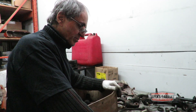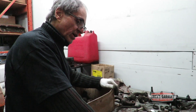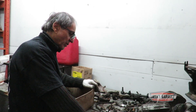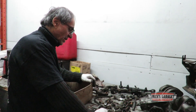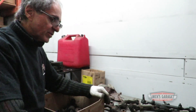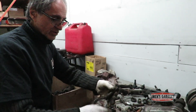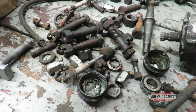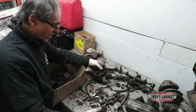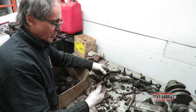The Kowalski project: my car came with drum brakes in the front and I want to convert it to factory disc brakes up front. I've got a pair of spindles, the caliper brackets, the calipers, and the discs, but then you need all the hardware — you've got to have the right bolts. So here's a mix of drum brake and disc brake bolts, and I've got to figure out which is the right part for my assembly.